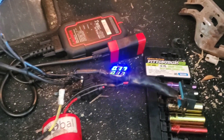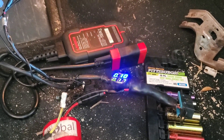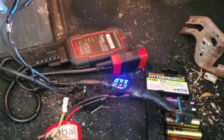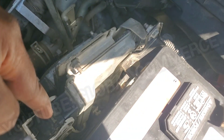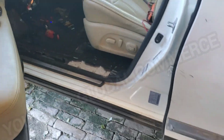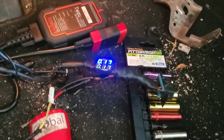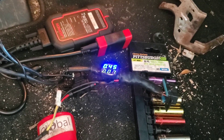So the first thing I'm going to have my tech do is disconnect the easiest modules — starting with the engine computer. So here under the hood next to the battery is the engine computer, and next to it is the transmission control module. These are the first modules on the network I would always target because they're so easy to get to. We're going to have him disconnect the transmission now, and if that module is offending — or something in the line with it is offending — it should bring the network back up.